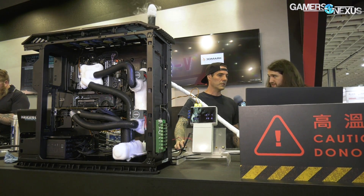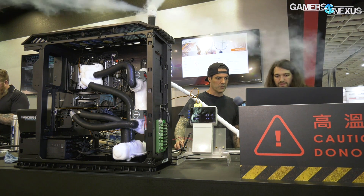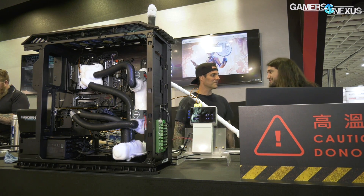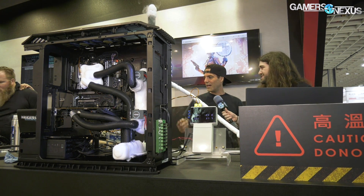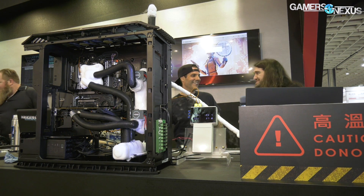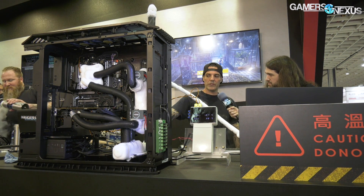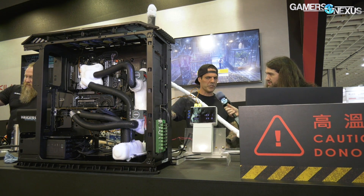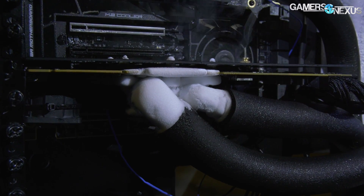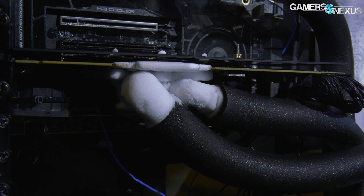And this is with the EVGA Elite utility — a beta version, but it's our Elite utility. The 7980XE is pretty well known for power consumption. The highest power we hit on the 7980 was around 900 to 950 watts. So we're going into graphics test one. The GPU is running maybe 1900 or 2000 — we didn't pull the GPU down yet. We want to make sure the CPU is solid and the system is running good, then we bring the GPU down.